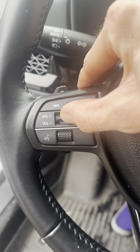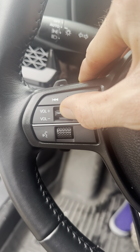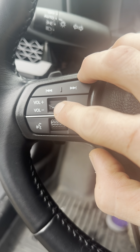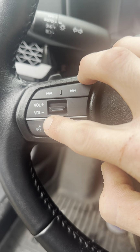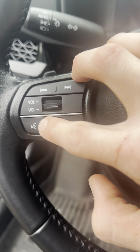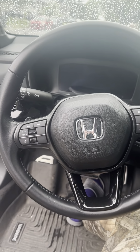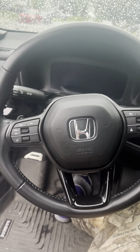And eventually I took the entire thing apart, and if you can see, let me try to get the focus, you can see that that corner right there is broken off, and the button that it presses is actually down in that corner. The top one's right here in the middle, and then the bottom one is down there in that left corner. So without that piece being there, it's just not clicking. So we're gonna go ahead and take this whole thing apart and replace it.